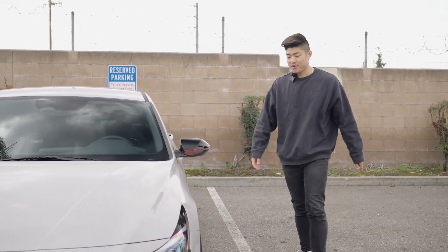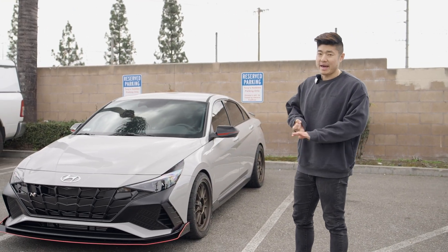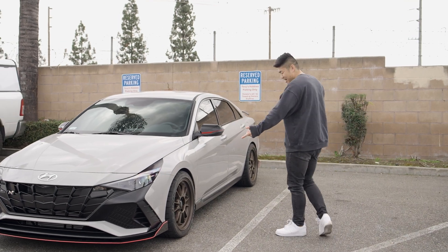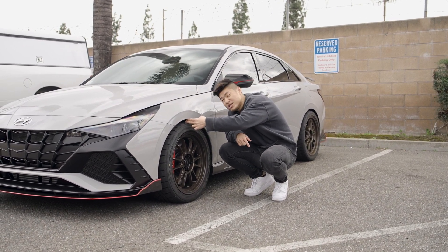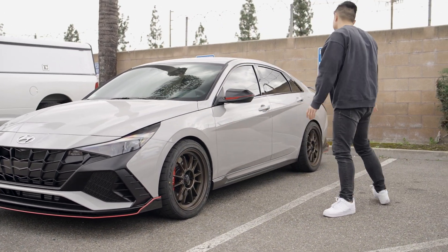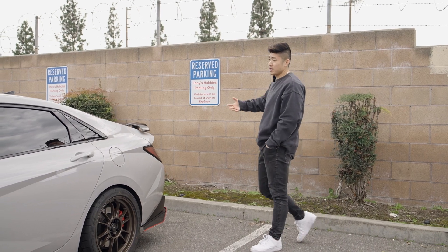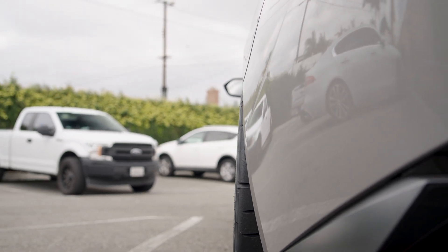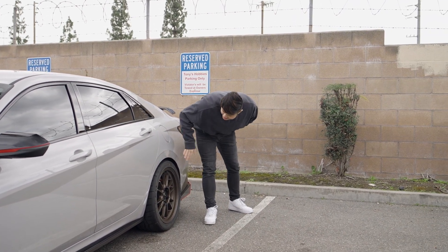Alright guys, we just picked up the car back from our buddies at Temple City Auto Repair. If you're in SoCal, they do the best alignments and have the best tire prices, hands down. They also sell wheels and stuff, so hit them up. As you can see, the car looks a lot lower now. I thought it would drop a little more — we had about a two-and-a-half finger gap, now it's a tight two-finger. It was a 0.8 drop. No rubbing at all on a 245/40 tire running an 8.5 wide wheel. It's pretty flush. We might get some camber bolts up front for a little more camber, but the fitment looks amazing.